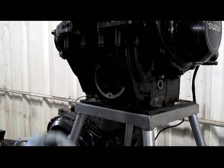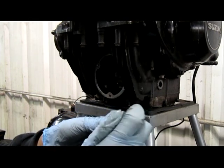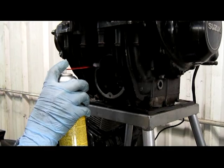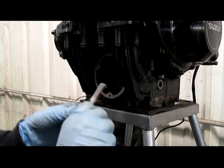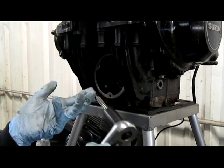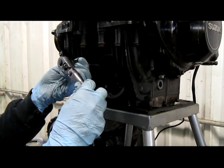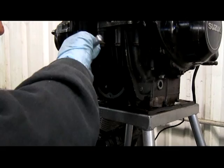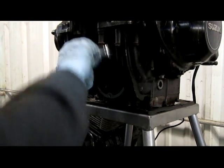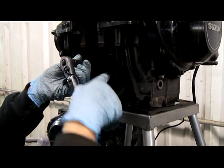Now you're going to drill it first. After you drill your hole, you want to tap it using your helicoil tap — I have a tap socket here, though that didn't come with the kit. Lube your hole. This is an important step where you have to make sure that you're tapping in straight. That'll dictate whether you've got straight studs or if your engine is going to be junk. Just like with the other tapping, you want to go in and then take it out, go in and take it out. You'll see some shavings — just make sure you don't get any of that in your engine.